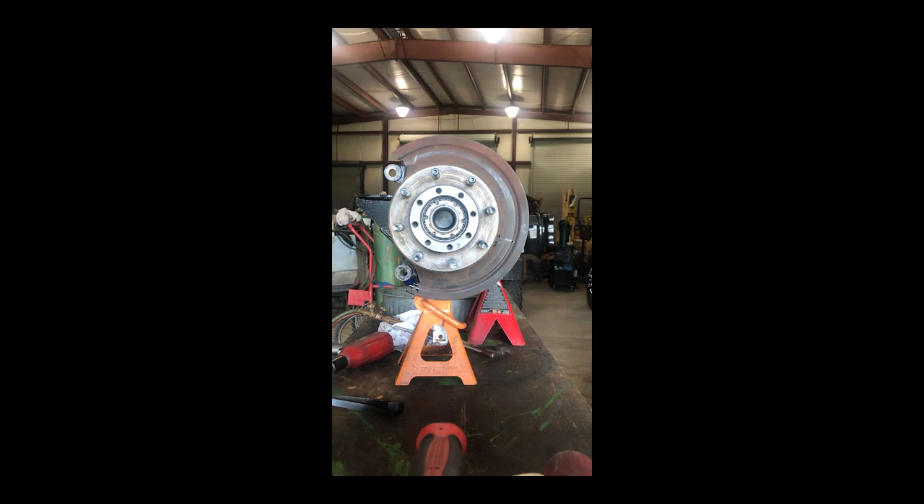It goes through those little pucks that are built and then torqued down in the caps for the differential carrier bearings. We use it just for reference and to be able to mic off. You can kind of see how crooked it was there to start with, and you'll see here in a moment — we'll heat this thing up and you'll see it move.